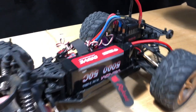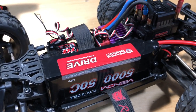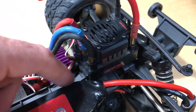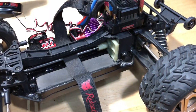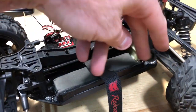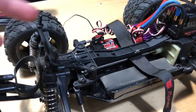I hacked this thing up. My buddy Scott came over and I was like, let me throw something together — put a brushless system in it and let's have fun. This Venom battery fits in there just about perfect the way it's notched. It just fits in here perfectly. I put a little velcro strap around the actual brace and a little foam piece in there. The original battery went in through the bottom — not anymore. I made it a lot stronger by putting epoxy in there because I took a lot of the rigidness out of the chassis cutting it up, so epoxy fills the gaps and thickens it back up.